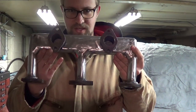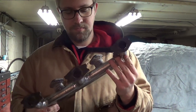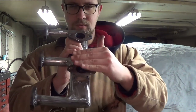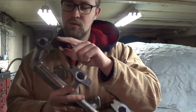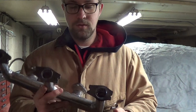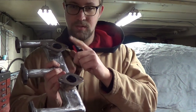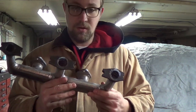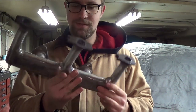Here is my finished creation - it didn't turn out too bad, in fact it might even be better than expected. I'm going to take this into work tomorrow and hop on the milling machine to mill these two flanges up here flat. I'm not going to machine the cast iron ones because they were already machined when they were on the car, so they should be okay. I am worried about the carburetors not sealing up well. That's about all I'm going to get done for tonight - not too shabby.